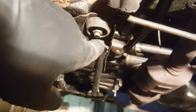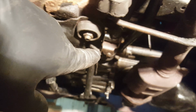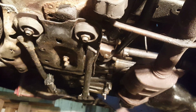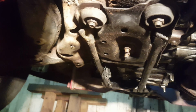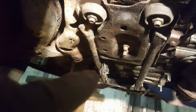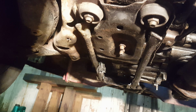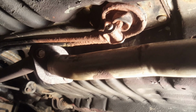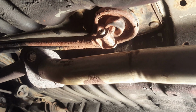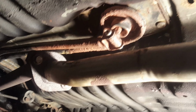Also, while I'm underneath there, I'm going to find and reinstall the reverse plug. Yeah, sorry for the focus. There's a reverse plug dangling around somewhere that needs to mate up to that reverse plug mate to complete that circuit. So I will do that. And then that would allow me to go back inside the car and finish installing the washers and nuts that hold the shifter plate to the tunnel.